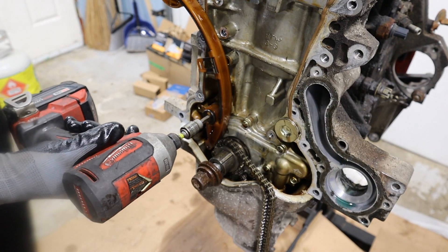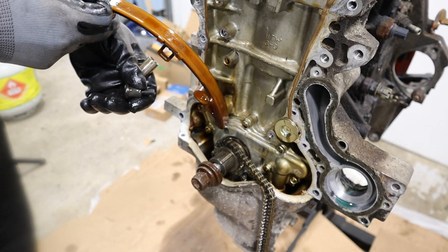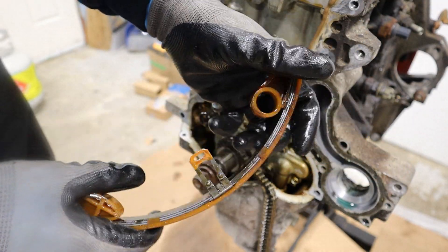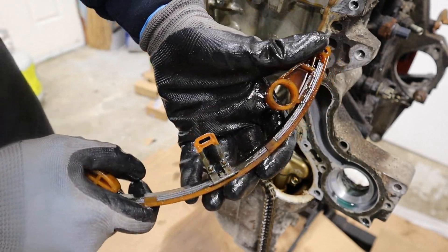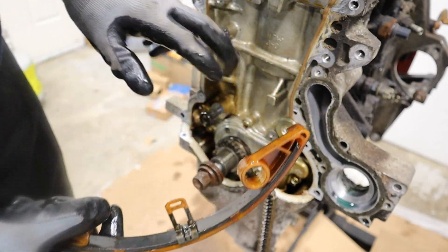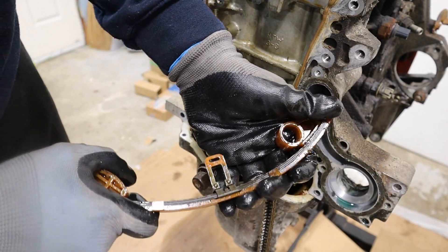You do need more than a 10 and 12 to take this off — this is a 6mm hex. This leaf spring design is pretty cool with a metal back leaf spring inside. What I don't like is that the hard contact points are made of plastic, but this is a very low stress engine and I don't expect this to be the main failure point. It's a lot more foolproof than the earlier B and D series Honda engines that had that cam you'd have to push in to check belt tension. This is a lot more robust.